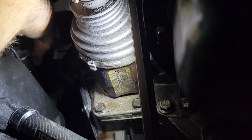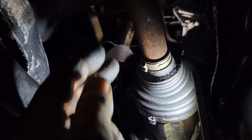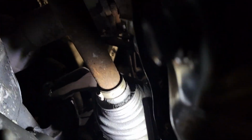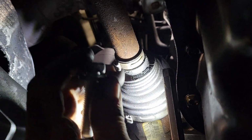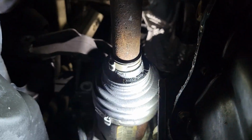See, the mount's everywhere there. And it's the forks of the mount bracket that hold it there. But now we got this 18 millimeter out of the side. There's a couple bolts from the top, and then we'll be able to take that bracket off of there and then take the whole thing out through the top.